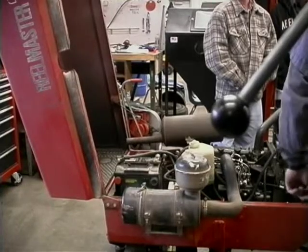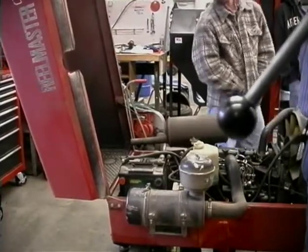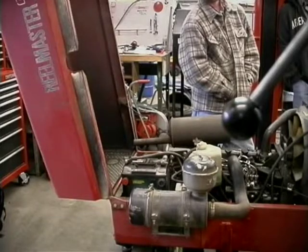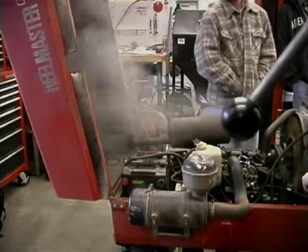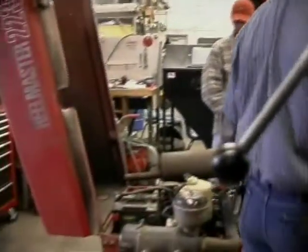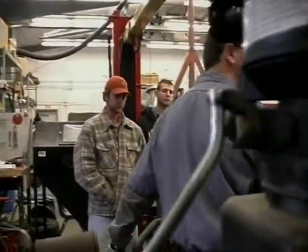Go to the on position. The light comes on and I'm going to wait until the light goes off — you'll hear it click and the light will go off. It's still on. That's the difference between using the glow plugs and not. This engine here tends to need glow plugs even though it's 65 degrees in here pretty much all day long.